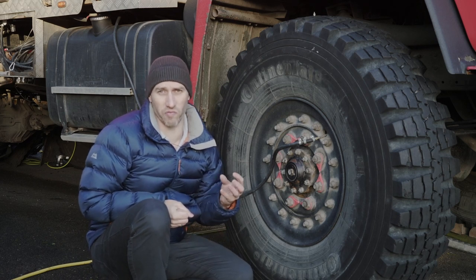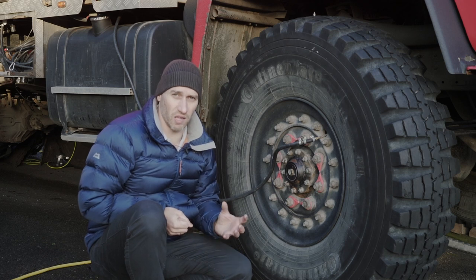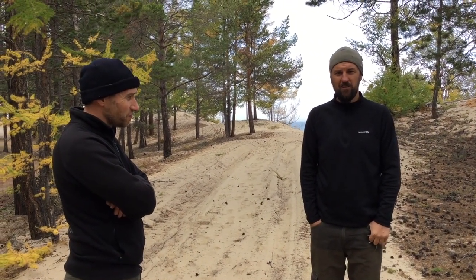Buy quality kit and make deflating and inflating your tires as easy as possible, because it means you're likely to avoid situations where you're trying to push your truck through something when you really should deflate your tires. We found a bit of sand — I like testing the abilities of the truck. She sunk in a bit and I was feeling lazy, so I didn't deflate. I put her in low ratio four-wheel drive and she was making good progress, but then one wheel found something hard, put a lot of load into that wheel, and snapped the half shaft on the rear. Now I had a front-wheel-drive truck stuck in sand on a hill surrounded by sand dunes.